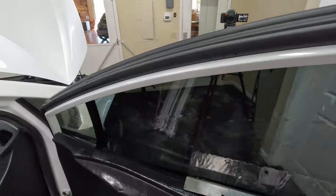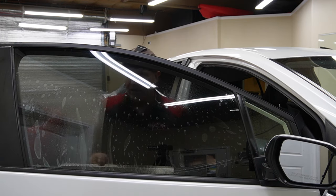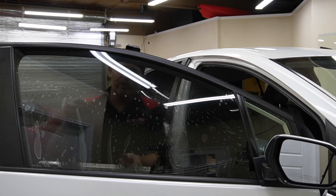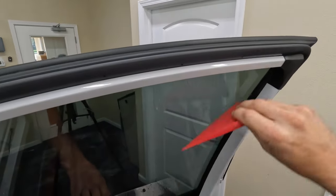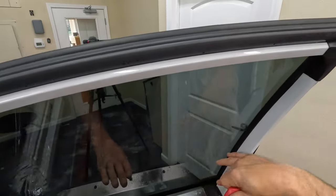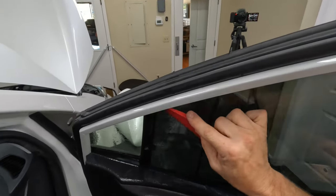That's not going to be the end of the world. Basically where I squeegeed it out to, it broke loose and came off the glass up higher. So let's get this tool now and just gently wipe it off so it doesn't have any grit or sand on it — wipe it off on your shirt — and then we can push this down. If your shrink wasn't good on the bottom and it's kind of curling up, you can go across like that as well. That'll help with that situation if you're a pre-shrinker. I'm a pre-shrinker.